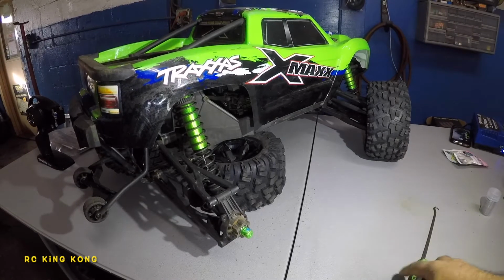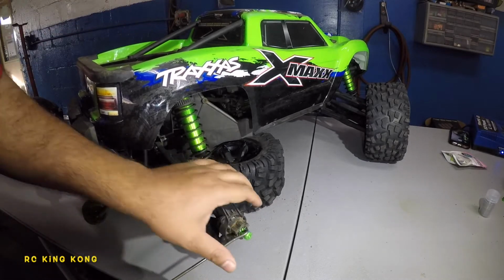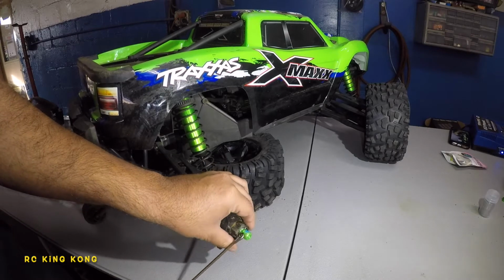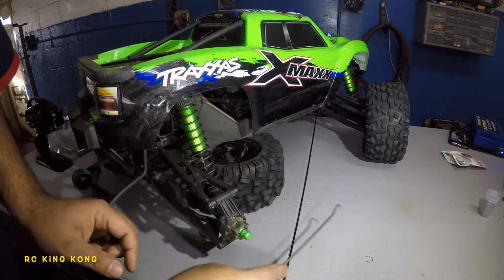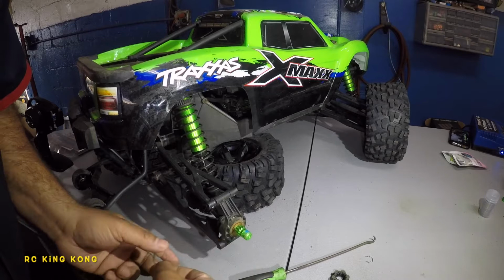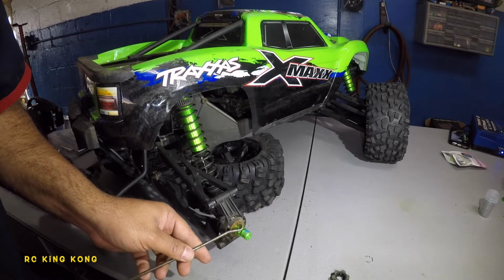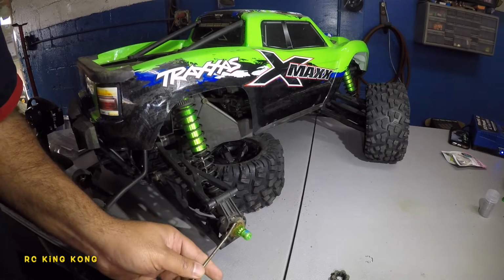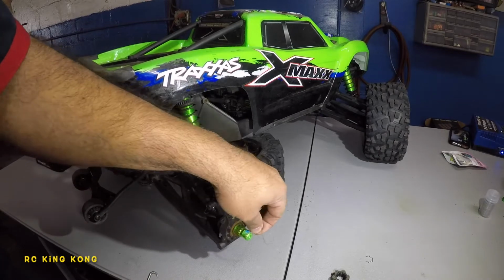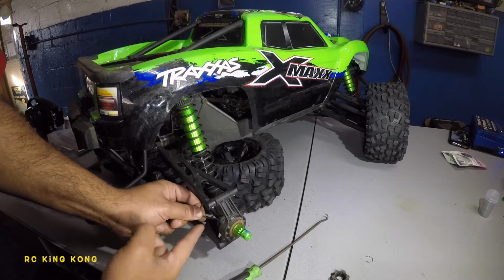So what we're gonna do is, you see this little pin right here? If you want, you could blow some air on it, clean it off, dust it off. This little pin, you're gonna use a flathead or a needle nose or a pick like this. Just pop open this pin, don't lose it. Without that, nothing is good. Then this guy should come off, and inside we have a whole bunch of stuff that we picked up this past winter from the fake grass looking field right next to the baseball field. And let's remove all this crazy stuff from right here. My bearings are still good, it's just that the external seal race came off right there.